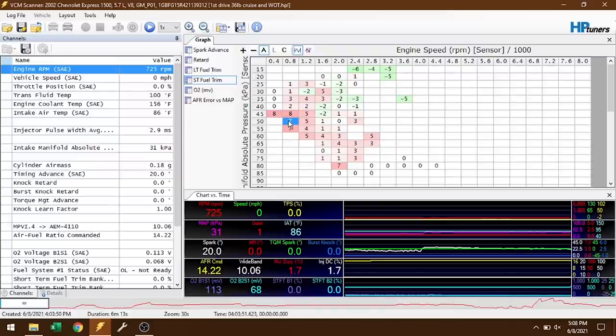and I probably just need to make a few slight tweaks to the VE table, because if you remember back when I did the 0411 swap, there was no VE table from a Vortec 7.4 in an 0411 computer. So the VE table that was on there was adapted from an 8.1. So anyway, that's just to say that I'm actually really happy with how the thing drives.